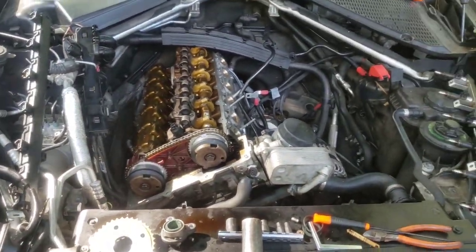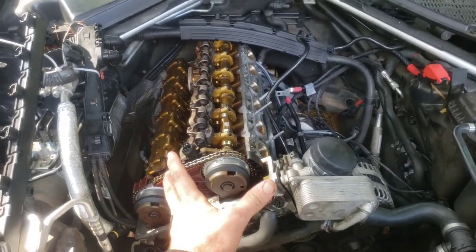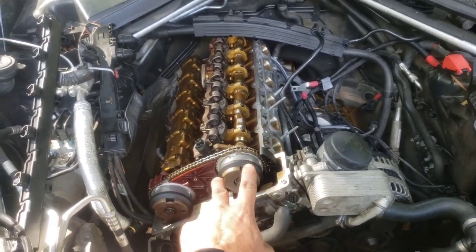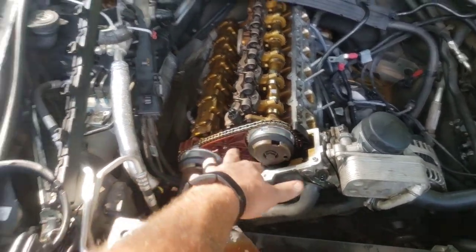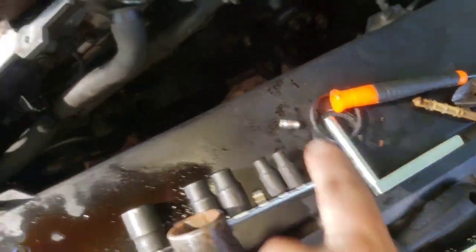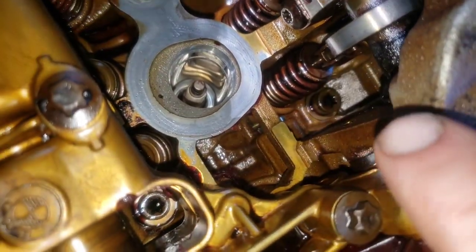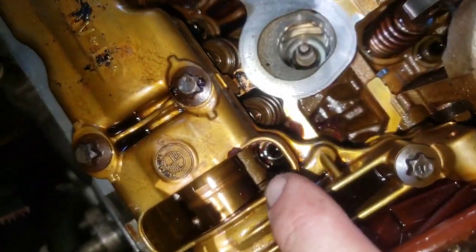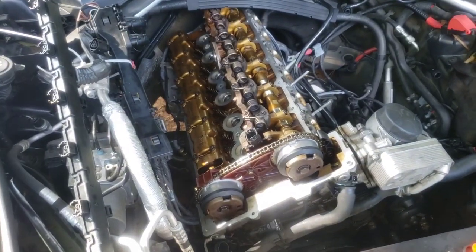Thanks for watching — I hope this helps somebody. There was very limited information when I was looking all this stuff up: does it bend the valves? I've seen at least two cases where it did not bend the valves, so maybe there's hope. Once you put all this stuff back together and you've got it all timed, you're going to want to go through and look for your little bolts and studs. Drop the drain pan. In mine, I had two sitting right up in there and they're not magnetic so you've got to get creative. I had one sitting right in here and it dropped, so you'll probably have to pull the oil pan.